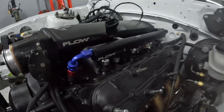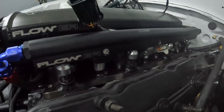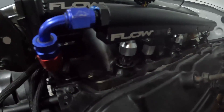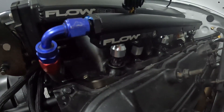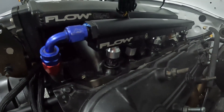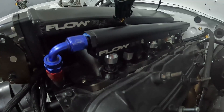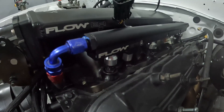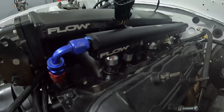We'll start right up at the front here with the injectors. These injectors are Bosch 210 and I purchased them from VS Racing. One thing with these guys is they are very short, so you have to use an injector spacer. I had to do some measuring and space the rail up. I could have saved myself a lot of time if I'd just talked to Varen at VS Racing originally about the spacers — it's something I didn't realize I needed.